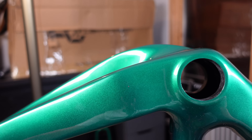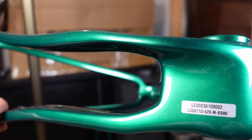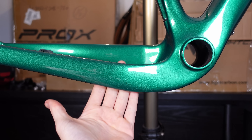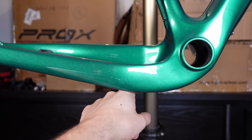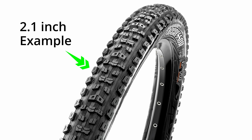When digging around the bottom bracket, you can clearly see the asymmetrical design of this frame — the chainstays are not the same. This asymmetrical design is obviously deliberate, and it's done to give extra tyre clearance. Considering that this frame has clearance for up to 700 by 53C or 650B by 2.1 inch, I think they've done a pretty good job. I'd like to get some big fat tyres to really tackle the crustier winter weather here in the UK.